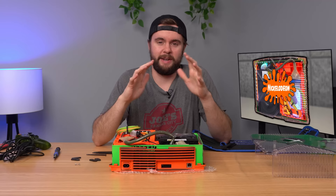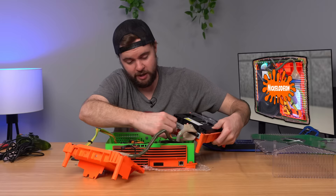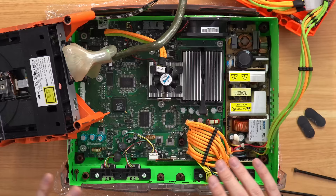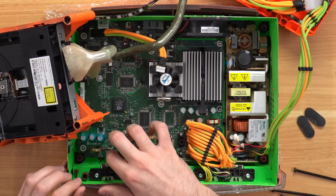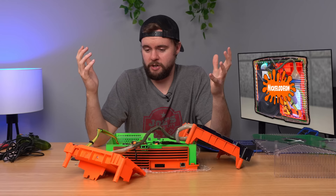Looking over this motherboard, I don't see any signs of any hardware modification — no mod chips, nothing of that nature. We do have the braided cable additions which look nice and add to the aesthetic. The clock capacitor has been cut out as well, which is good to see because that thing would be leaking all over the board by now. Thanks for watching — let me know down below what you think about this console. Overall I'd probably give it an eight out of ten because I really like the aesthetic. It's a bit beat up, but it is a used console that wasn't built just for me. Thanks for watching and I'll see you next time.